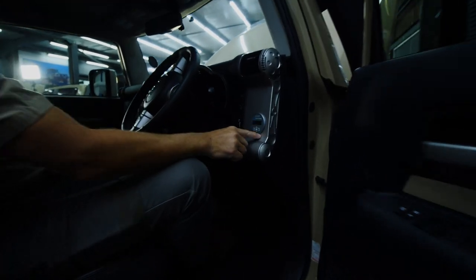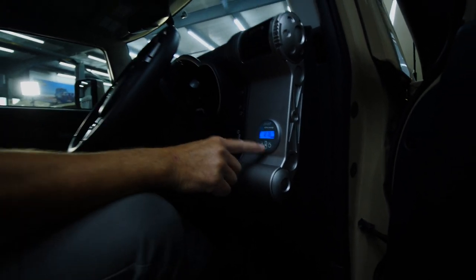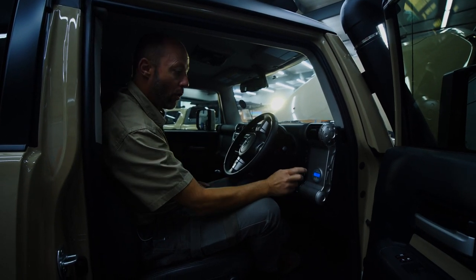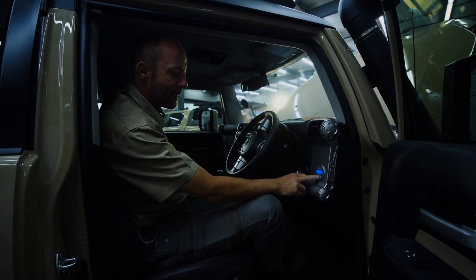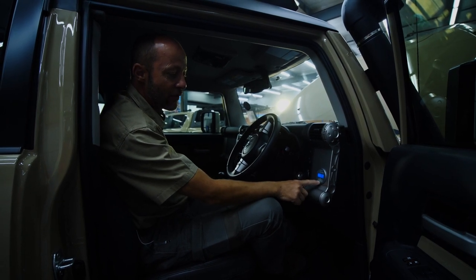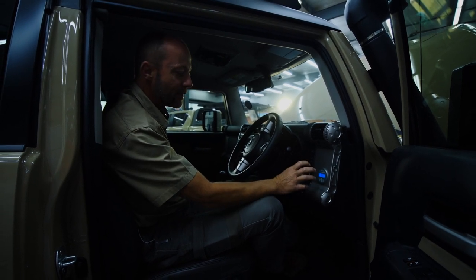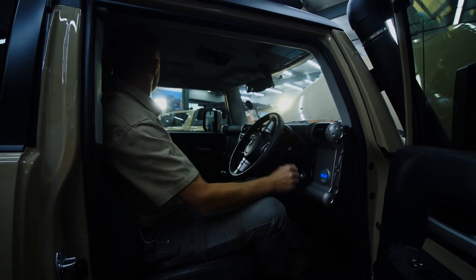This is the Victron Energy display unit. So very neat piece of kit. Main battery voltage, auxiliary battery voltage, and then importantly is amp draw or actual current being put back into the battery when it's being charged. So you can see all of that and you can see the state of your battery. Currently the second battery has lost 3.6 amps since last full charge. It's at 96.1%. So that is, you know, way better having this than an actual voltmeter.